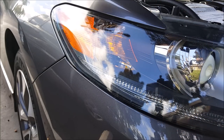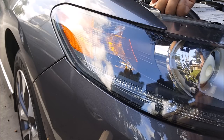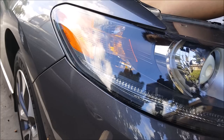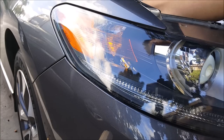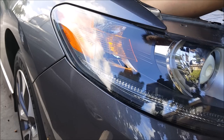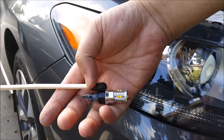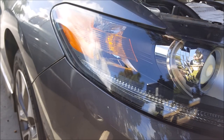I'm going to put the chopstick into the headlight housing, grab that bulb with the double-sided tape on the sticky side, and pull it out. Hopefully I don't have to remove the entire headlight housing to get to it. There you go — it's grabbed onto it, and it's out! All it was was a chopstick and some double-sided tacky tape. I didn't have to remove the bumper, I didn't remove the headlight, and I was able to take this out in less than a minute.